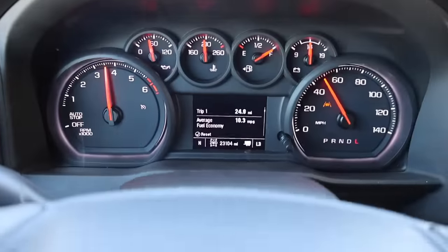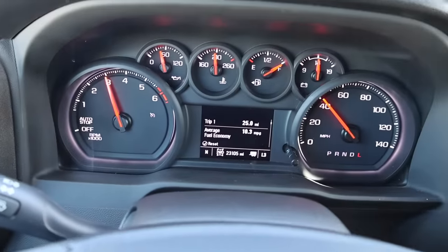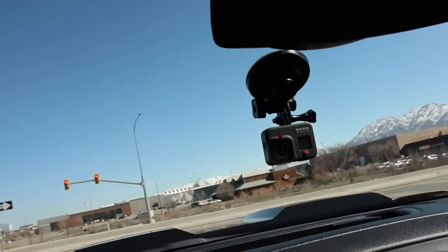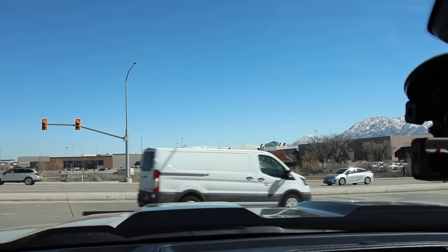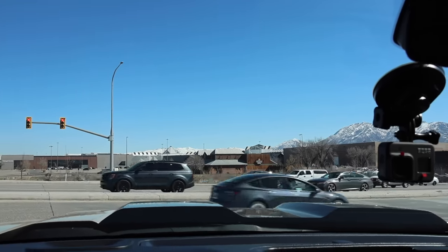By the way, you get extra clicks when you have a trailer too. I didn't know if I said that yet. Here are the RPMs for downshifts. This transmission is pretty heavily protected, so you can't really get the RPMs you need to slow the trailer down. So you're really going to have to keep the gain up on your trailer brake, and be ready to stop because this truck does not help any with the transmission.